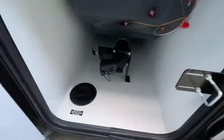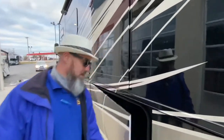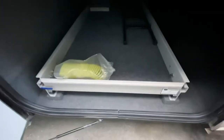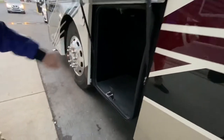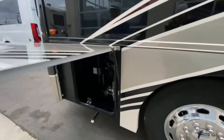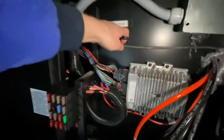You have your mid dump here. Since this is two full baths, there are three tanks — black and gray, and then another one that's technically black but holds all the water from your mid bath. Full pass-through storage here — it's big. Then you have your front furnace and more full pass-through. This does have a slide-out tray as well. There's the hose for the compressor and that slides out too. This compartment also has another air compressor chuck plus storage. There's your other fuel fill — both fuel fills go into the same 100-gallon tank. The last compartment has your hydraulics for the leveling jacks, windshield washer fluid, electrical components for the chassis, and the release for the slide-out generator.